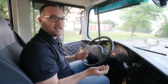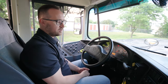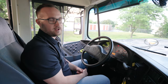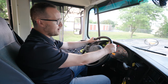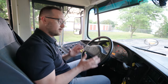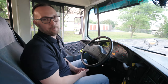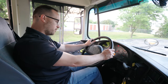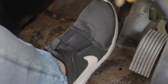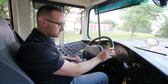Once I'm done with my fans, the last thing I need to do is going to be all my braking tests. Today, since we do not have an air brake vehicle, we have a hydraulic brake vehicle. We are going to do a hydraulic brake test, then we are going to do a parking brake test and a service brake test. So the first brake test I want to do today, I want to do my hydraulic brake test. While my vehicle is on, I am going to pump my brake three times and hold it for five seconds. If I have pressure on my brake, my hydraulic brake test is successful, but if my brake falls to the floor while I am doing my five second hold down on my brake pedal, we have a problem with the hydraulic brake system. So I am going to put my foot on my brake pedal, pump it three times, and then on the third time, I would hold it down — 1-1000, 2-1000, 3-1000, 4-1000, 5-1000. And I do have pressure on my brake pedal to conclude that that is a successful test on the hydraulic brake.